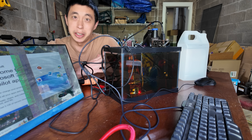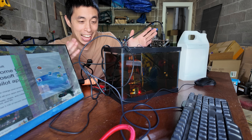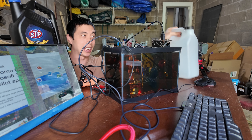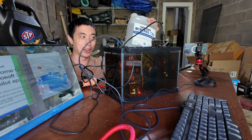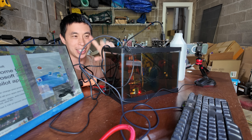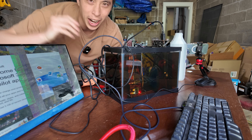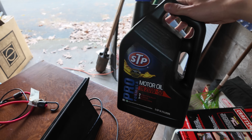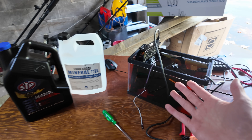All of that said, if we go back to the initial question — can you use motor oil to cool a PC? — the answer is yes, you for sure can. And in fact, motor oil is quite a bit cheaper in volume compared to mineral oil. So if you're looking for a cheap alternative, motor oil obviously does not destroy a computer within the first month or so. But stay tuned for updates as we continue this experiment over time. Would I recommend this? Well, the answer is kind of obviously no. There are a ton of downsides that make this inconvenient to have around and deal with. If you are looking for a substance to submerge your PC in, mineral oil is a clear winner over motor oil in terms of ease of use — but functionally, they do both work, which was the whole goal of today's video.